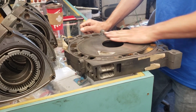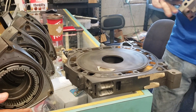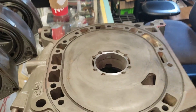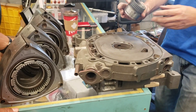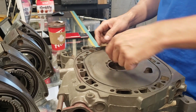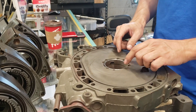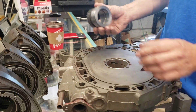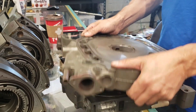This hasn't been machined in the center — this won't get any machining done to it. This is the four rotor iron right here, and this is the gear that gets machined and put into it — that's the housing. This is what makes the four rotor unique from two and three rotors — you have to machine the center. You can see how it starts out with that blank hole there, and then it goes around the perimeter, machines it to exact tolerance, gets the locating grooves put into it. There are little allen heads that screw in here, and that's what keeps it from twisting.